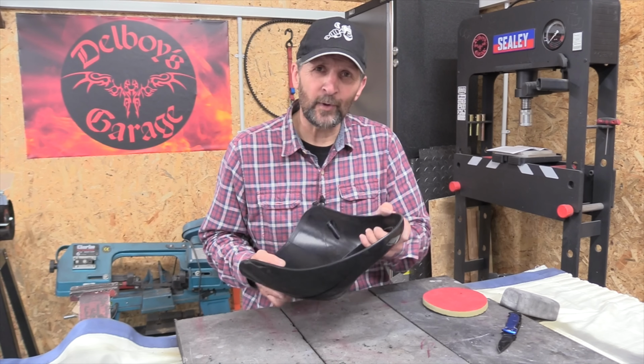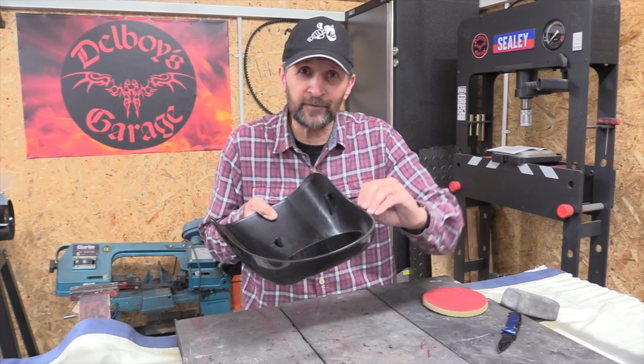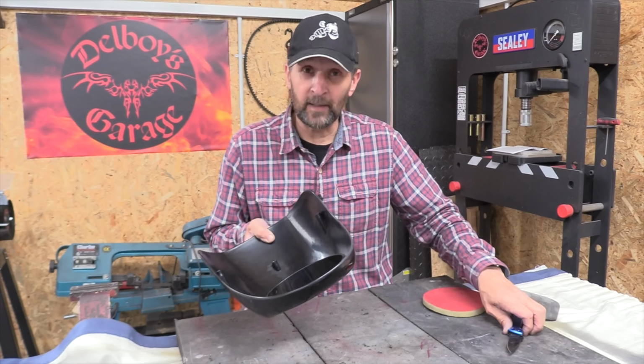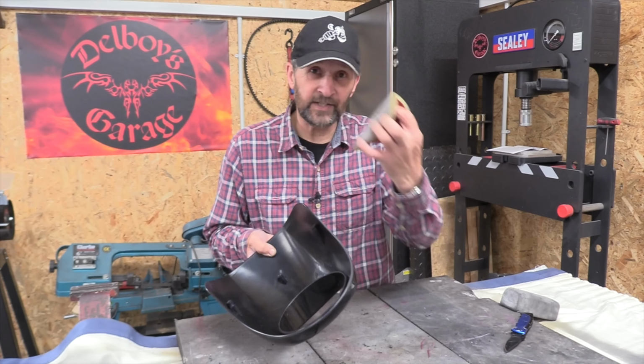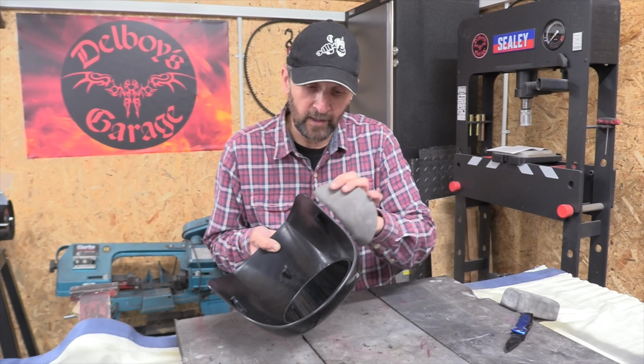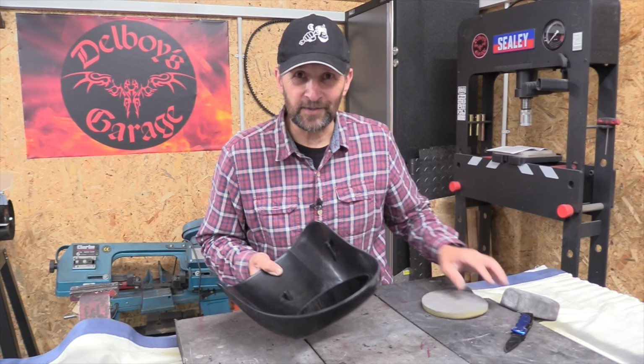Right, if you ever made Airfix models as a kid, then you know all about casting flash. It's just that little sharp edge left where the two molds meet each other. Take a blade, stroke it out the way for the most part until it's almost gone. Then take your 600 paper and just stroke away at it until that's a perfectly rounded edge all in one piece. It's just patience.